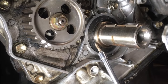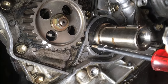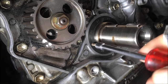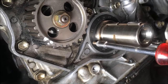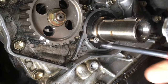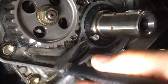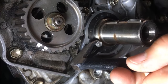Now we're going to screw the screw in there — we're going in about four threads. Now we're going to use a nail puller, that's all that is. Just a cat's paw nail puller to pull that seal. Grab hold of the head of that screw or one of the threads and pull it.